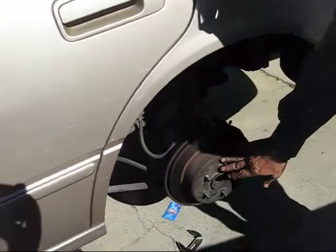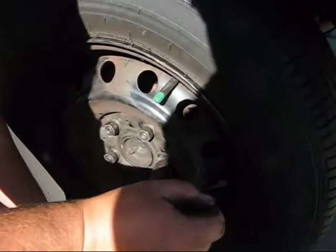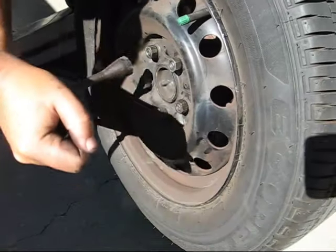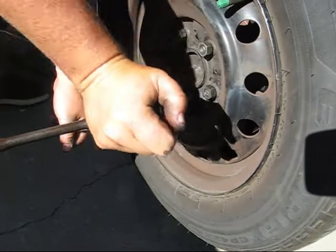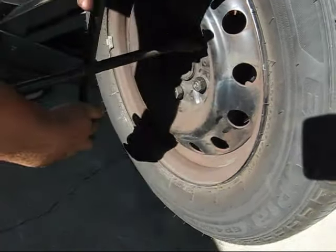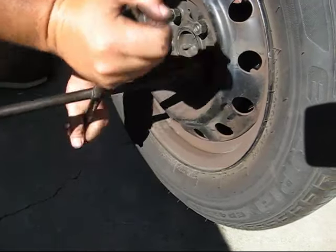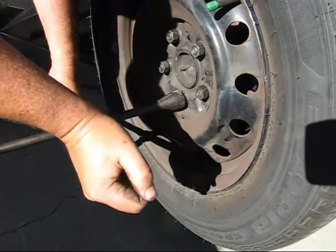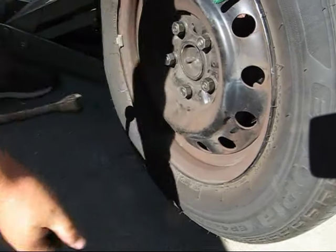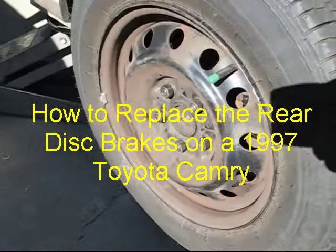Put the tire back on and that's doing the brakes. Remember the last thing: when you tighten the wheels, make sure you go in a star pattern — that way it seats the wheel evenly. I really like doing it by myself putting the wheels on and tightening up, because if you get it done in the shop they use an air gun and just zip them right on. Then if you ever have to take them off on the road, it gets really tough. But anyway, that is it.